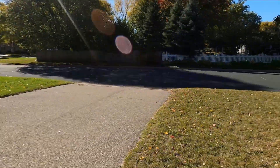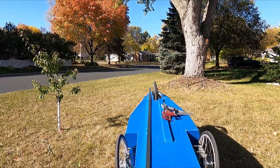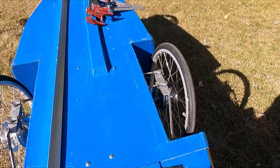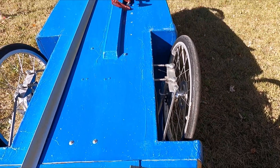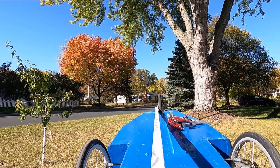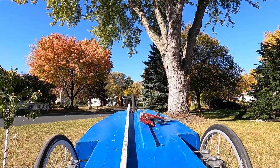So I'm out here today with my Velomobile and I've got it turned over. I'm going to see if in fact I got the rear wheel trued up. I did a little bit of measuring from this rod here to the front of the wheel well — to the line where the nose attaches — and it is the exact same measurement. I'm going to run this metal bar, which is about as straight as anything I own, cinch that down to the rear wheel, and do measurements to see if in fact that is square.